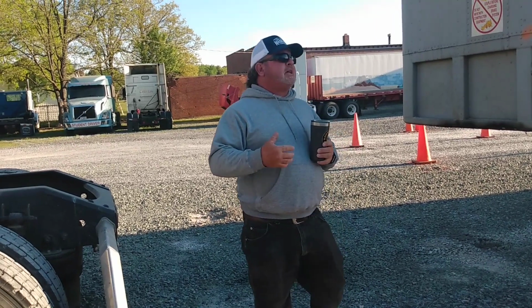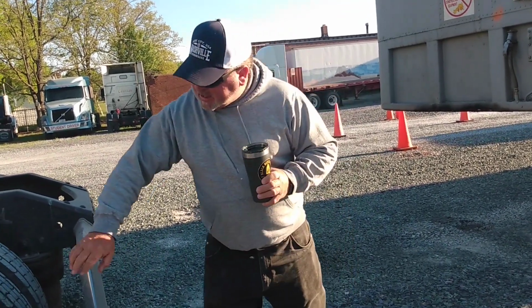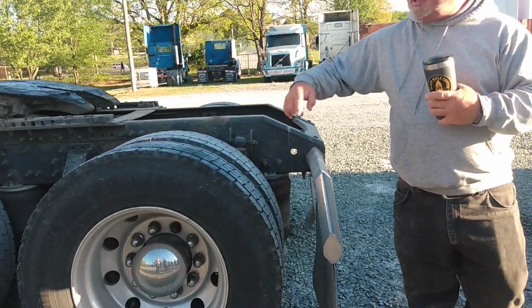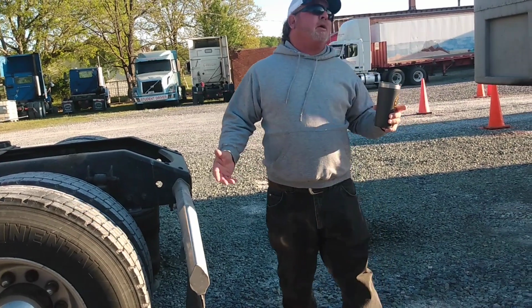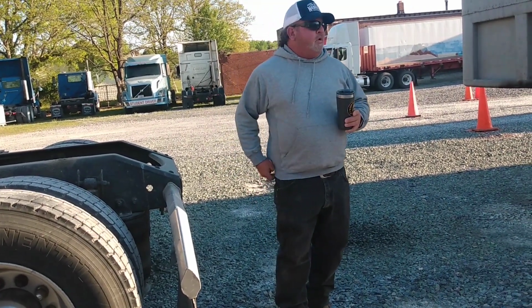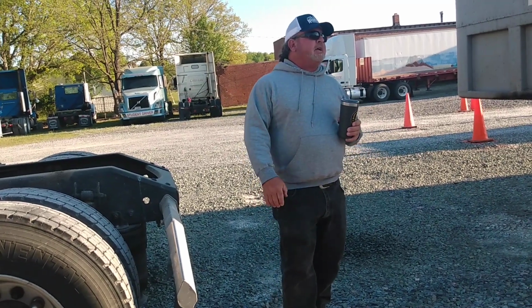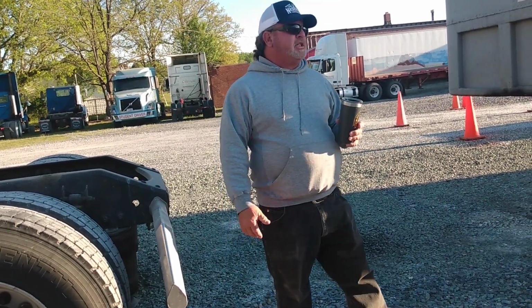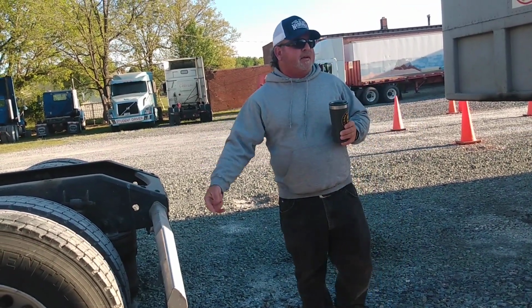When you get in a low traction situation, mud, snow, whatever, flip that button, it locks this back rear end in. So that way you got 2 sets of axles pulling. All right? Kind of like 4-wheel drive, not really, but it's a lot better than one. You would think these trucks with all these tires would go anywhere. But it's total opposite. You spin under the wheels and they're like a turtle on their back. So you need all the help you can get.